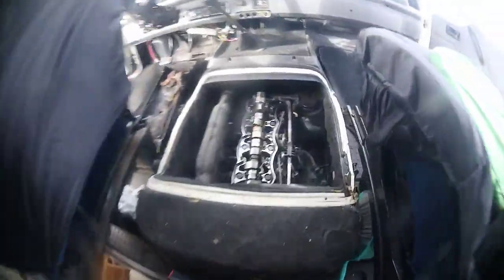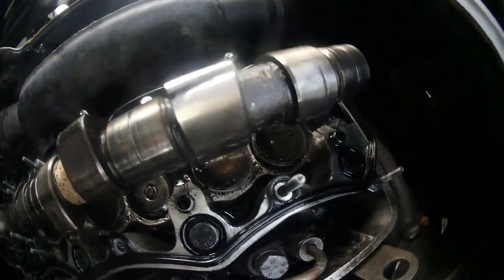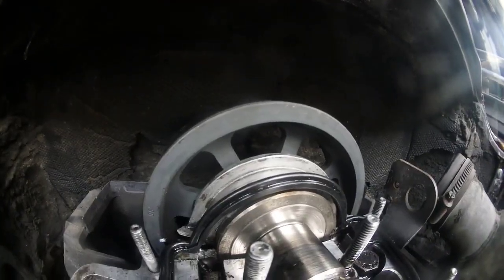When we arrived here in Amexel, we decided to have a look under the motor - open up the metal top cover and look at the situation with the valves. Because it does make a little clatter sound, which is usually a sign that there might be an issue with the valves. It's been mentioned in the comments a lot as well. So we opened it up and at first glance it looked good. Then Paul was feeling in the gaps - little holes filled with oil - and suddenly he pulled out this. Which is a shim, for a shim bucket, which is part of the valve system.